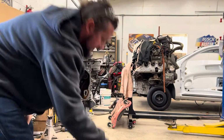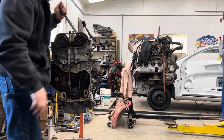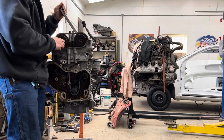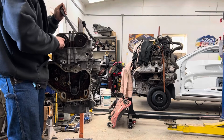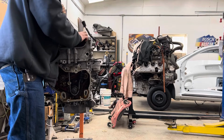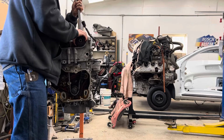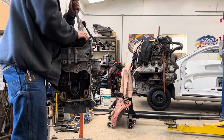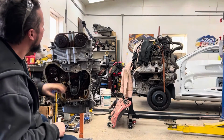So, we have a 15/16 wrench. It fits on the camshaft. This one is on the pin where it's supposed to be. I'll put the bolt back in it. Drop that bolt on the floor. Okay. Your exhaust cam phaser is back where it's supposed to be. Now you're going to have to take the spring out of this one to get this pin on. Means turning it this way slowly until you get it like so. So that one's on, that one's on.